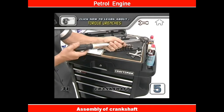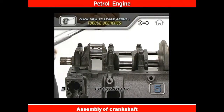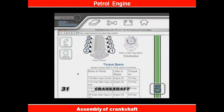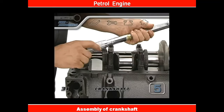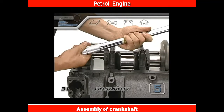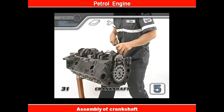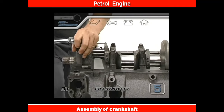There are many different kinds of torque wrenches available, but there is one common rule: you should never simply set the wrench to the full torque spec and tighten the bolt in the first pull. The right way to use all torque wrenches is to work up to the full torque spec in at least three equal increments. For example, the engine specs for this block say that these bolts should be torqued to 70 foot pounds. First, set the wrench to 20 pounds and torque all the bolts. Then set the wrench to about 45 pounds and torque again. The settings don't have to be exact thirds, just in the ballpark. Then set the wrench to the final 70 foot pounds and finish it off. If you have four-bolt mains, do the inner bolts first, then the outers. Be careful while you're torquing — you can't bump the crankshaft or rotate it at all, or the readings on the plastic gauge strips will be screwed up.